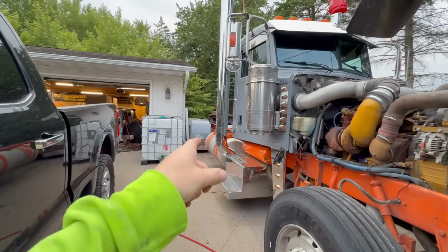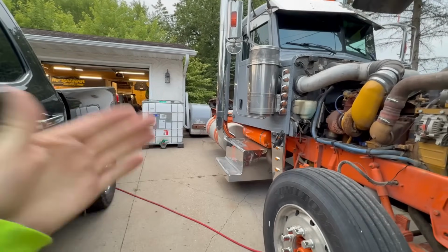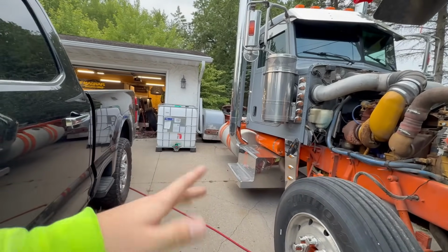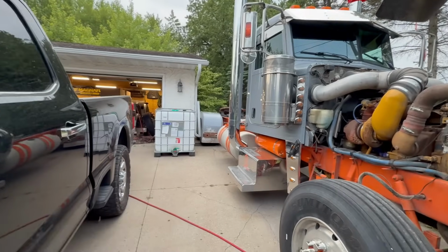And we're gonna do a rear cutoff on this at some point when we get more into racing, because this style suspension is not really great for racing. It's gonna hop, doesn't have full lockers. We're eventually gonna switch to a new way, so I'm not gonna spend a bunch of money on doing brakes and all this shit on this when I'm gonna change it. So we're just gonna make this work. I do need brakes because they are fucking gone. But the front axle we're gonna keep.